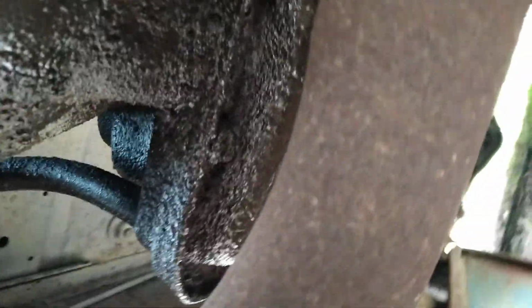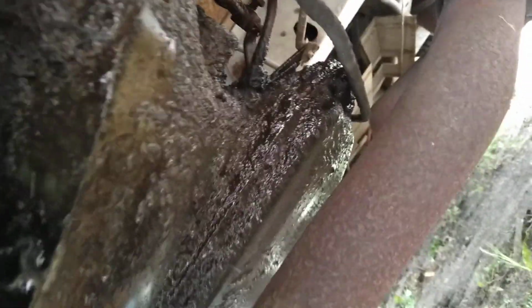That's leaking the rear main seal too. If I get all the bugs out, I wouldn't be opposed to really pulling the motor out of it and putting the seals in it, and maybe even rebuilding the tranny if it needs it. I've got an extra one. I think it's the same thing out back, so I could probably get that all going through and check everything out and pull that one out and put this one in. But yeah, that's pretty grubby looking there. I think that's a rear seal. Or most of it could be the transmission pan.